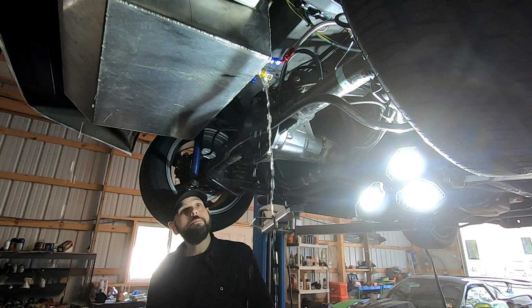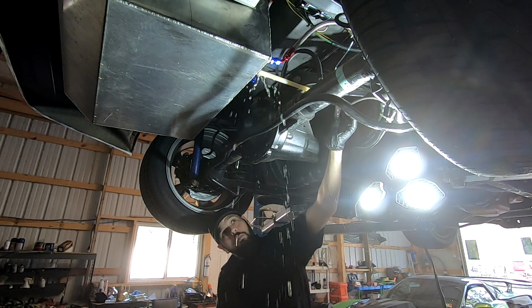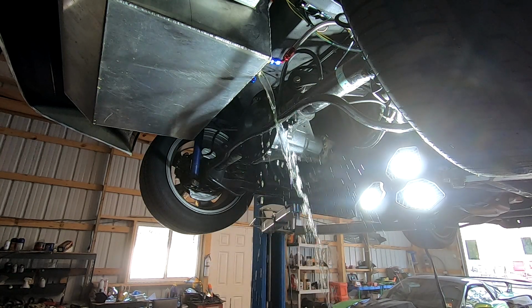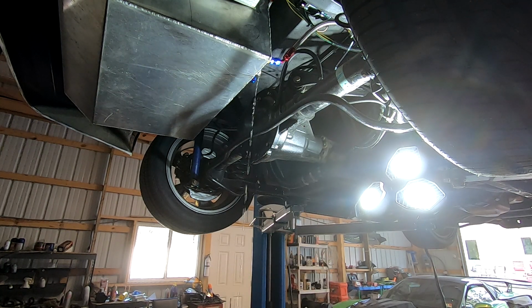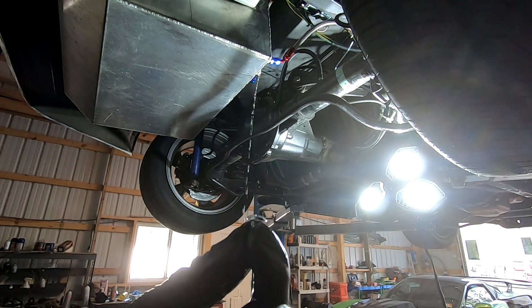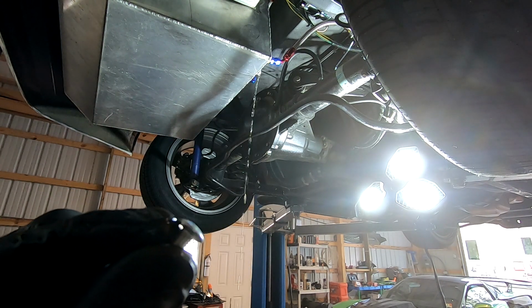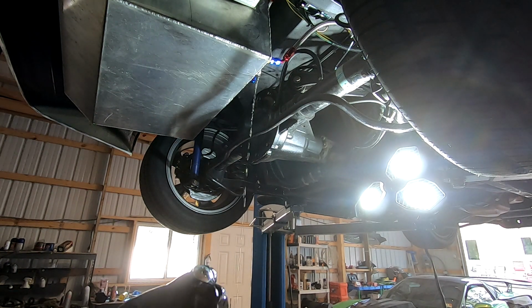Definitely could have done without this. Yeah, I regret that. You're not gonna believe this, but this was in the pickup tube. That's what was causing my restriction the whole time. All the bolts are accounted for in the sending unit. So I don't know how this got in there, but this is definitely a sending unit bolt. Maybe there was an extra one I didn't notice, but that's my problem. Something simple caused all these issues for me.